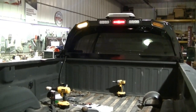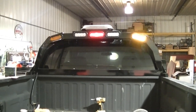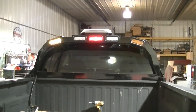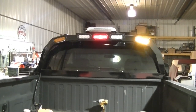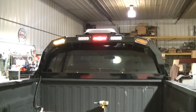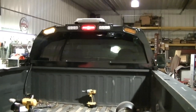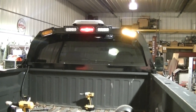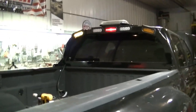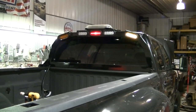For the third brake light I just tapped into the plug that plugs into the brake switch right on the brake pedal — that was pretty easy. For a ground, there's a bolt that holds a dash support and I grounded everything to that. Wiring really isn't as difficult as some people think — it's pretty much a power source and a ground, it's pretty simple.